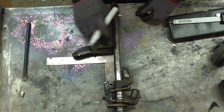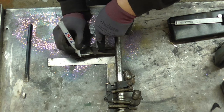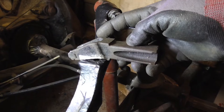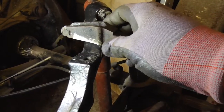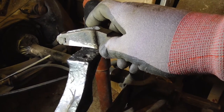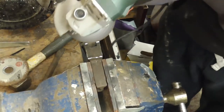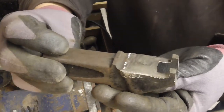Because I want to attach this here at more or less 90 degrees — it's not essential but I'd like it. I'm basically cutting this out here because of the lip underneath it kind of fits naturally there, which is a nice place. So if we cut it out at an angle where I've drawn it, it should be 90 degrees to the stay on the jack, which is how I'd like it. I've also checked to make sure it's not too wide to go between the body mount, so should the body be in place you can still put it in there and it should hook behind where the body mount bolt is. So it should work with or without the body on — we're just going to shape it into a hook so it'll hold in place either way.